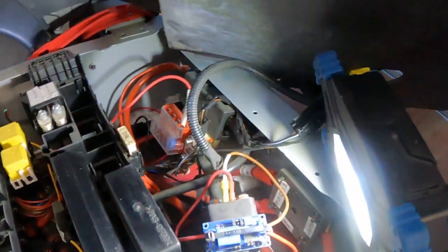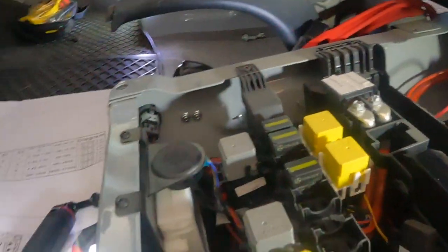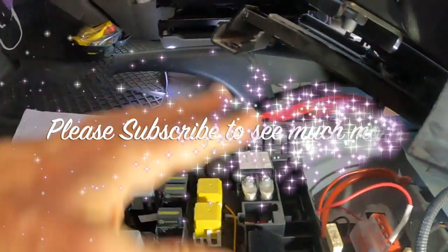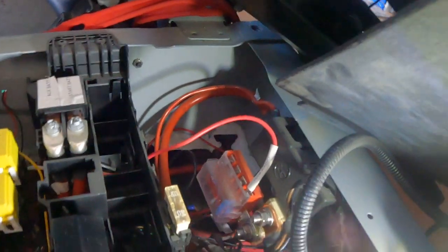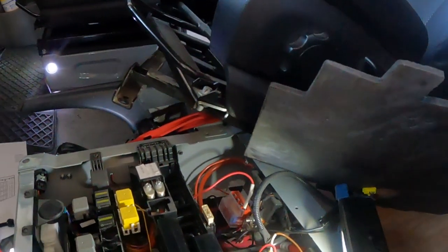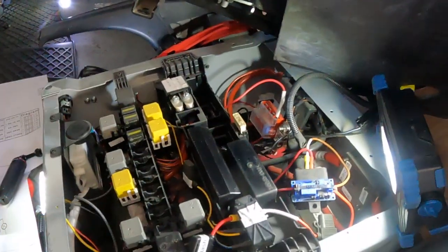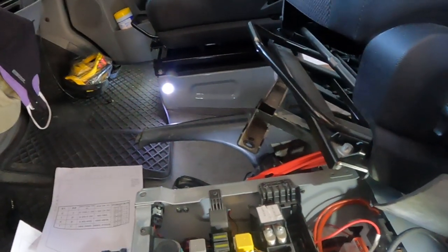The starter battery cable to the house battery switch is a bit smaller since starting is only a very short intermittent high-current event, so it doesn't need as large a cable. I've also added some lights that turn on when I open the doors for extra light. My ham radio is mounted on this side with a remote up in the dash. Down at the bottom of the seat base I've stuffed in a bunch of Thinsulate because there was quite a bit of noise coming up through it. The metal seat base bolts right to the floor with no insulation, so this gives a much quieter driving experience and reduces heat transfer — especially on the passenger side where the exhaust runs underneath.